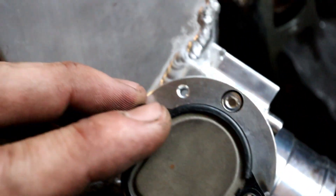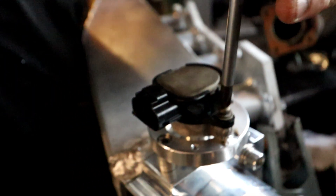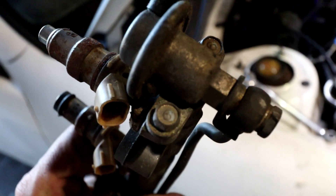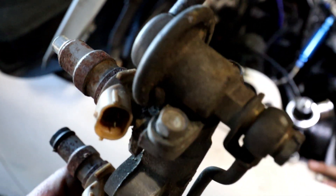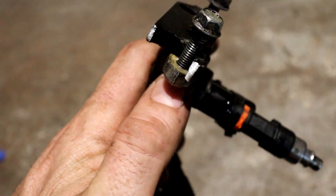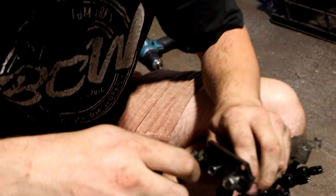We welded that into place. We tried putting it on and we've got dramas. Tried to bolt it on and Nick's got some dodgy looking fuel rail adapter that goes to a 5/16 hose. If we go and modify the bottom of it there's going to be nothing really holding that bolt on anymore, and the adapter could blow off and potentially burn this car to the ground.